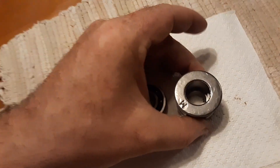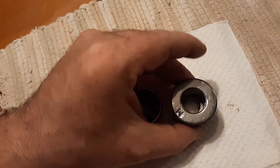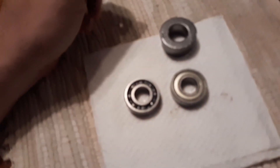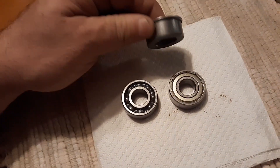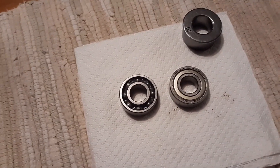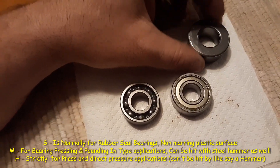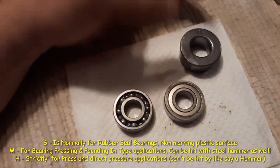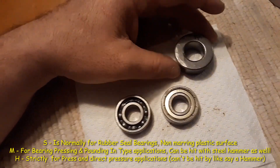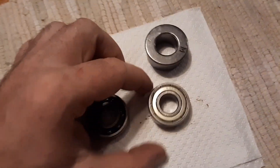I actually have a blank that goes in with a plate that sits flat and a pin that goes right through the bearing to keep it aligned so you can pound them in straight. Anyways, these are super handy — it's just a bearing press blank. The M stands for the type of material: there's S, M, and H grades, all with different purposes. This is the one I use for motorized bicycle builds.